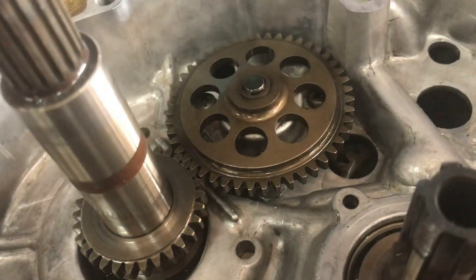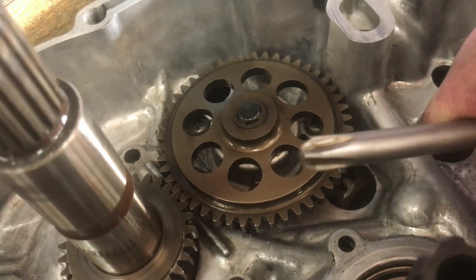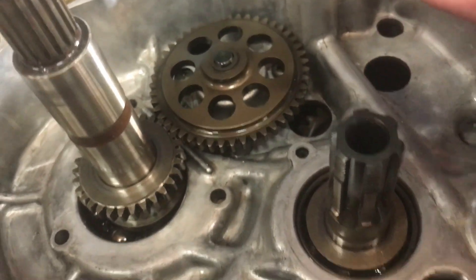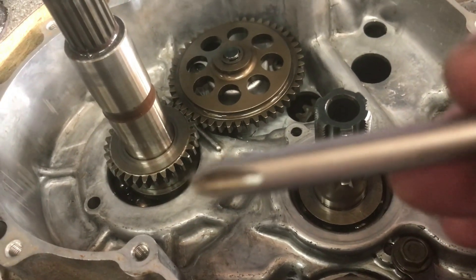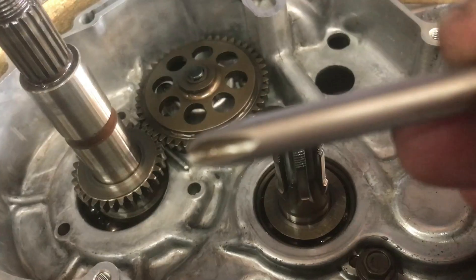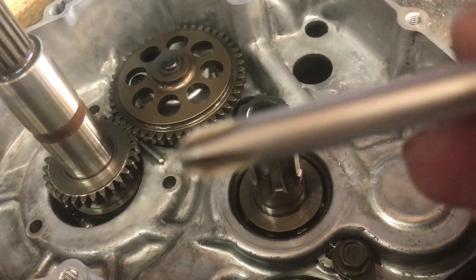That's the oil pump fitted. One of the tricks with the oil pump is getting the Phillips head style screws out - they're actually JIS standard. The tip I've used is for my impact driver; it's quite a large Phillips head with a blunt nose. The screws fit very nicely with no play in it, and it bottoms out properly. It's important because if you don't have the right tip, the screws are fairly tight and they have a tendency to strip the head.